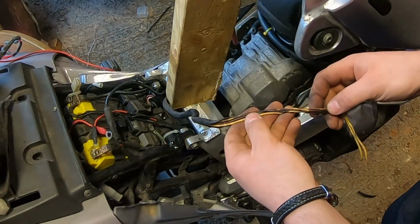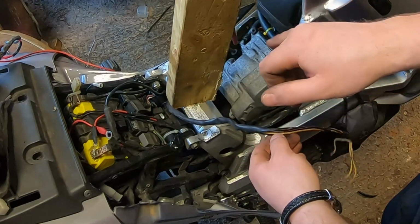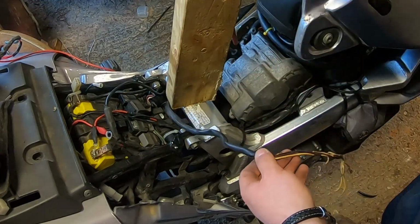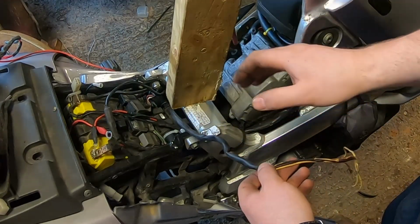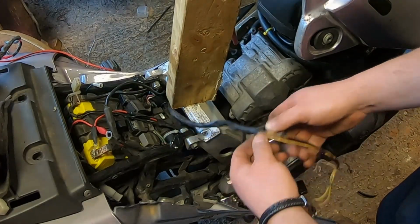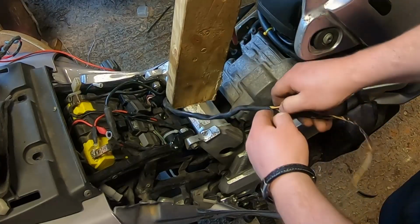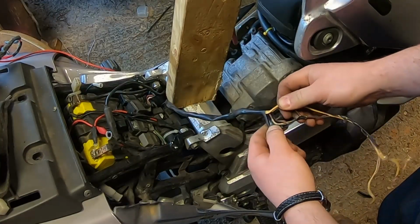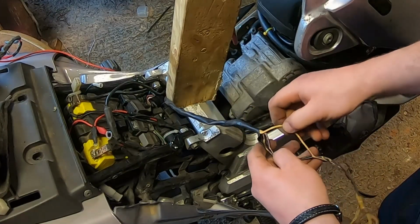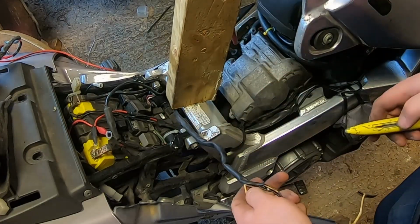Well, you can see why the brown connectors melt, because I think this wiring is original. Okay. Problem is, down there, these cables are wired directly onto the stator. So I just need to get back to the best bit, probably right at the other end. Oh, look at that. Bloody hell. That was not far off a short and a fire at all.